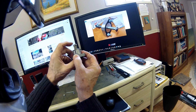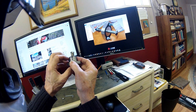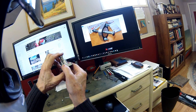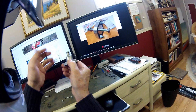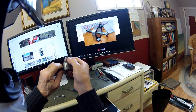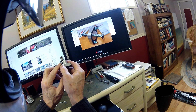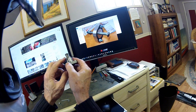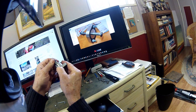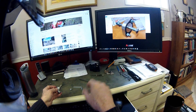A couple of these other ones that went before — unlike this one — backed off, one of them by about a quarter of an inch. I can't understand how that could occur given the mechanism, unless that bolt at the bottom wasn't locked somehow and could just turn back. My theory is that past the halfway point of adjustment it just doesn't have the spring tension anymore to push against the chain to take up the developing slack, and I think that's what's causing the problem.